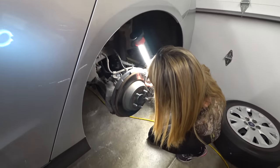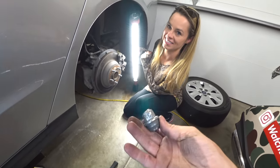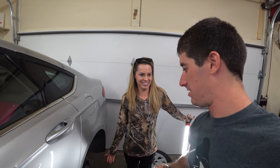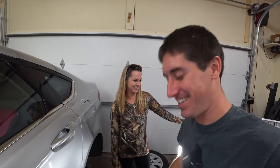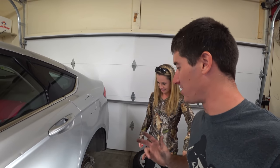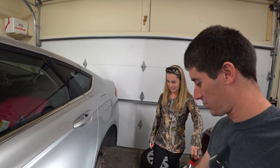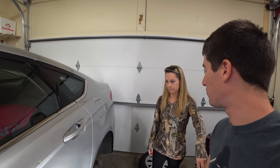This thing right here is the pad. It will be a super easy quick job. It is the back ones, which I didn't even think existed. Your lug nuts are definitely trash too. Front wheel drive does not have anything to do with the brakes — you always have brakes all the way around. That's a common misconception. We need two lug nuts because weirdly yours were completely toast. I've never heard a dealership say you need to change lug nuts. They're 20 mils and they're just trash. So two lug nuts and brake pads for the rear and we should be 10–15 more minutes ready to go.